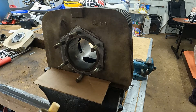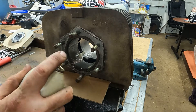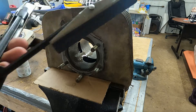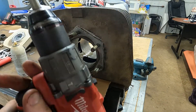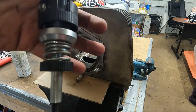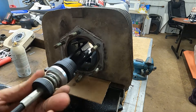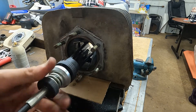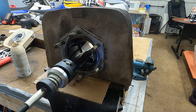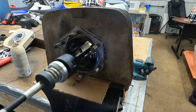Let me show you guys how to hone this. I use fogging spray for this — you want some kind of lubricant like maybe WD-40 or something like that if you don't have fogging spray. Just want to get a little oil in there, and then we're going to use this hone on my drill. These hone stones collapse, they're flexible, and you can adjust this spring down here to set the tension. I don't want a whole lot of tension, but I want some. The more tension you have the harder it's going to cut. You want to run the drill slow and you want to keep steady forward and back motions.